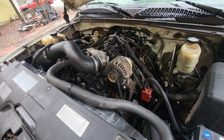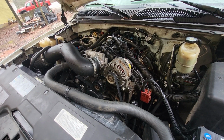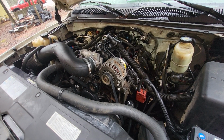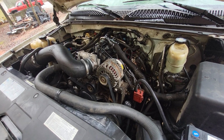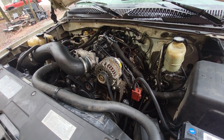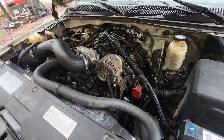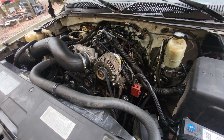Before, it was pretty much close to 90%. It was high up there. So I was out of injector and it was spark knocking. Now with the new injectors, now that it's able to have the fuel, it's not as bad. With the added compression, I had to pull a couple degrees here and there. So I data logged it and pulled timing out where it needed to come out.